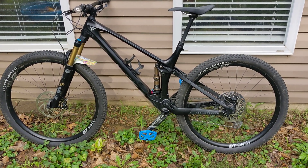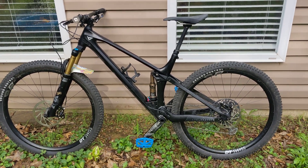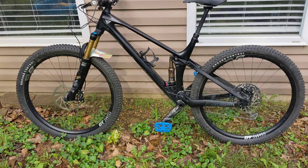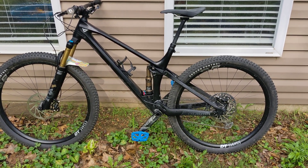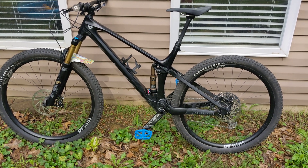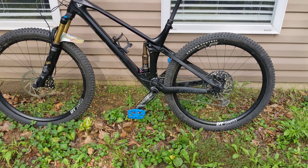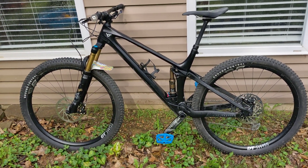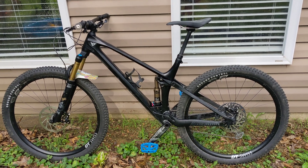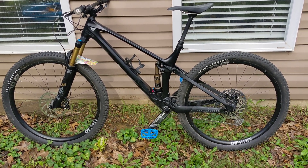It still pedals extremely well. I don't feel like I'm giving up anything, except maybe on a smooth road — in which case just flip the lock switch and the thing locks out. So no different there. But as far as a comfortable ride absorbing all the little chatter and that sort of stuff, it's so much better now. You fight to build speed with your legs, but if your shock is harsh, every time you hit little bumps it slows you down because the rear tire is bouncing back as it hits the rocks — it won't move up and get out of the way, it just chatters and you lose speed. So with a plusher setup, you can maintain the speed that you've worked for and carry it a lot easier. You can go around corners faster. I think that is the single biggest free upgrade you can do to this bike by far. Thanks for watching.